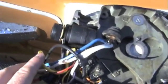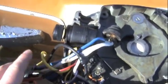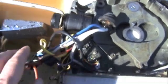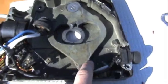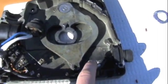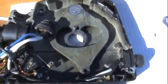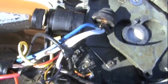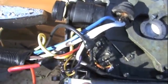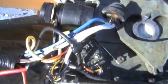Anyway, it's pretty simple to get all wired up once you know what all the wires are — you just solder them back in. The main thing is getting the wires out of the way of everything else. This little thing here that moves — you've got to make sure the wires aren't sticking out far enough to where this thing will hit them, or your gearbox won't shift the way it's supposed to. It's really tight in here; you've got to work hard to get everything compact.